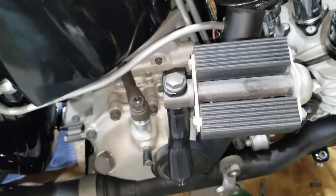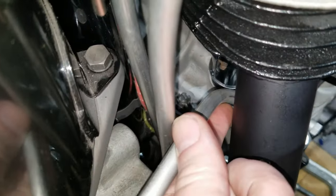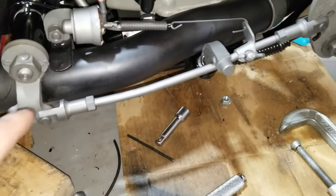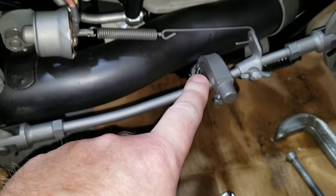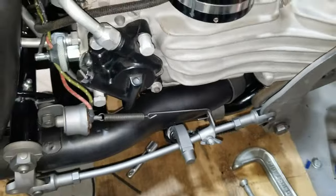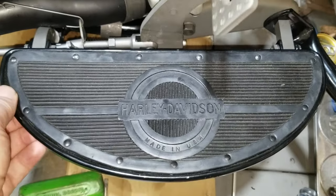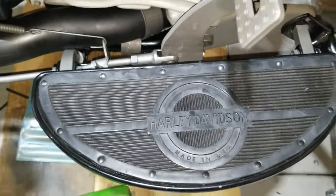Now that it's been sitting a while, we know the feed line has been getting oil. I want to reference again that this oil line is clearing this exhaust pipe really nicely — this is the feed line to the engine and this is high-heat exhaust, so we don't want that interfering with oil going into the motor. We also got all the mechanism hooked back up for the rear brake — it's all lined up good and clears everything. We're going to be ready to probably put the floorboards on too. We got the floorboard installed — this is the half-moon floorboard. 1940 was the first year for the half-moon floorboard, and it carried on through the 60s.